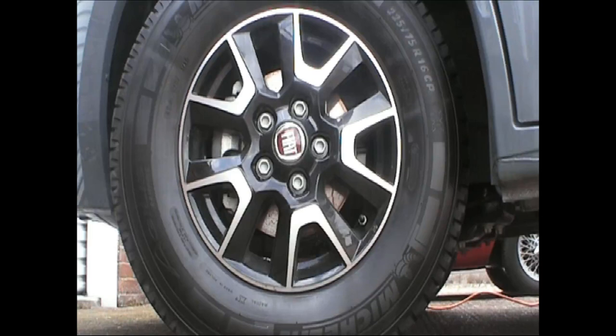As you can see, there are five wheel bolts, so what I've got to do is identify what thread is in the wheel. Normally they would come with an M14 1.5, 30mm long. But best to identify them because some come with M16s, and I don't want to go ordering them and finding out I've got to send them back because they come from Germany. So let's find out what socket we need.